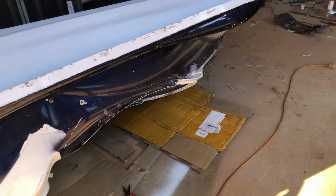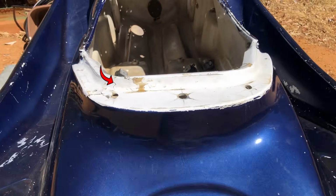On a side note, now that the ski is upside down to paint the bottom, this is the perfect time to address the reinforcement for cracks from a previous episode, where you can see that instead of trying to apply epoxy upside down, the epoxy and fiberglass can form a bit of a pool and really strengthen this weaker area with a thicker fillet. I've gone through and put epoxy filler where there is little dings and scratches and things over the hull, now that it has a good bonding surface. And I'll go through this process a few times to correct any changes in the shape.